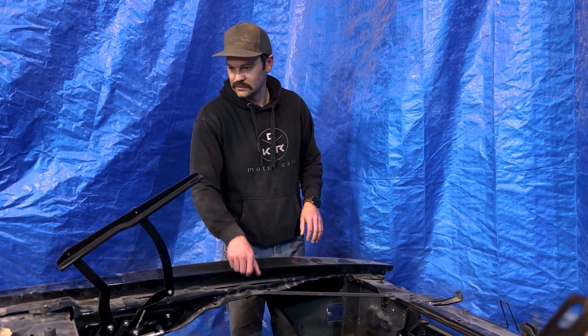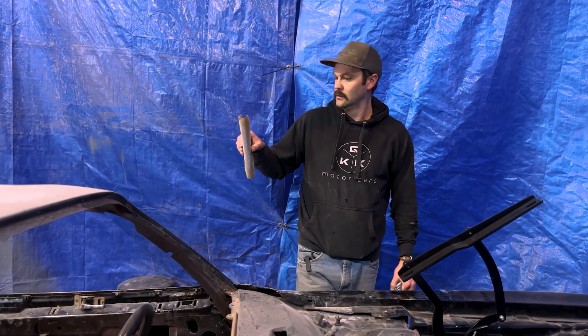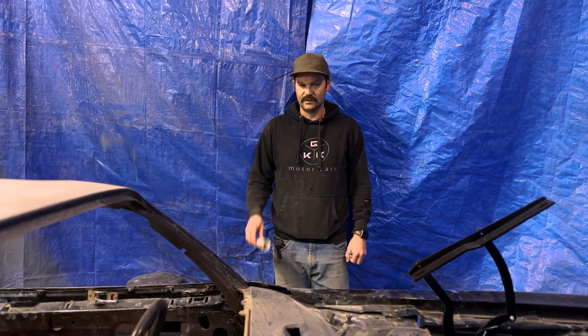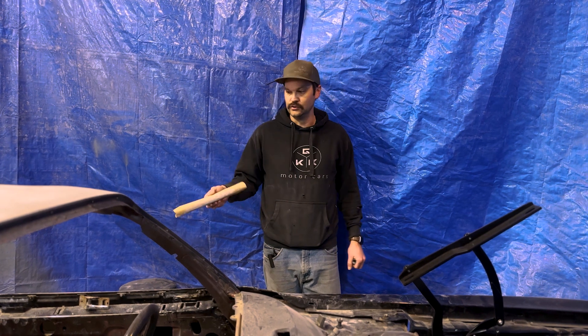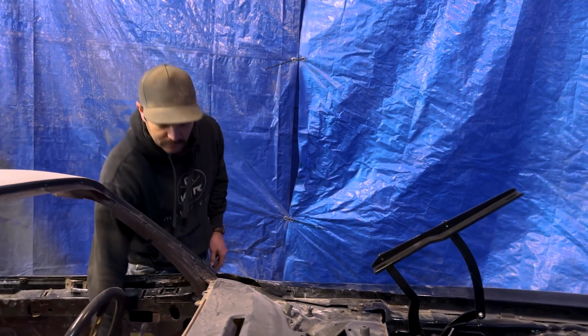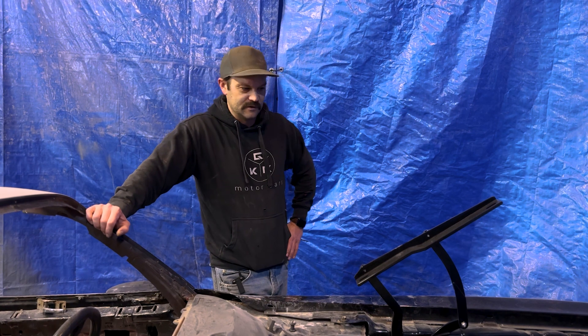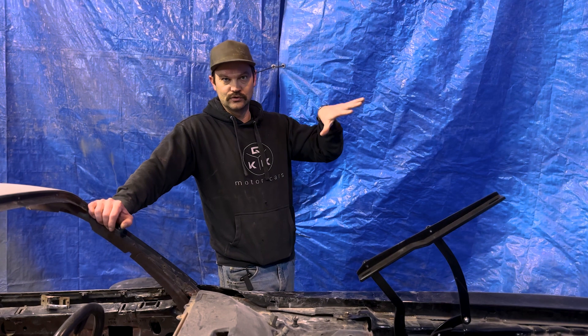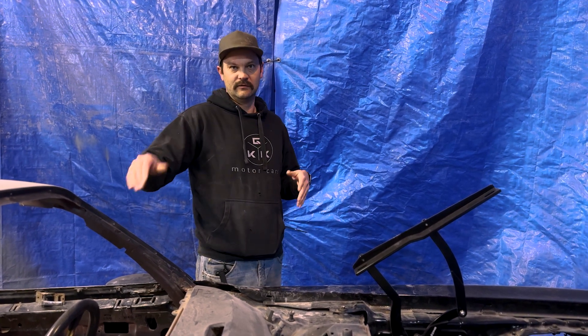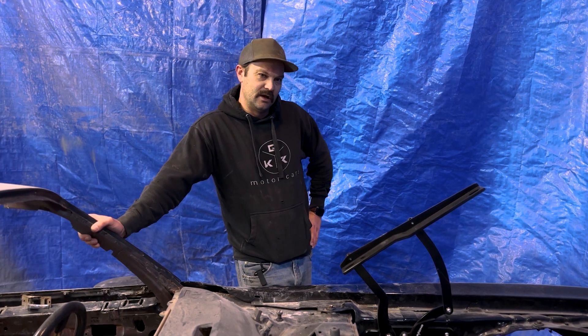Right now I'm just kind of clearing a few little odds and ends up here. We're going to put the hood on. We've got the body panels starting to go back on, getting some body lines fixed. First thing with this kind of stuff is hinges — new hinges. We've got new door hinges for the side doors and then new hinges for the hood. Hood hinges aren't absolutely necessary because they're a pretty basic design from the factory, but that's the reason why I like to go with new hood hinges. They're pretty thin and flimsy with these big old school hoods, and they kind of walk and bend. When you flex and put them down, they're just not sturdy enough for the weight. So I always like to go with these billet aftermarket hood hinges to make the hood opening and closing a lot smoother.